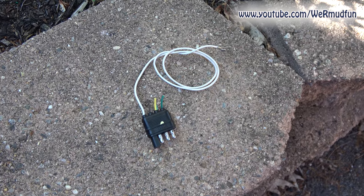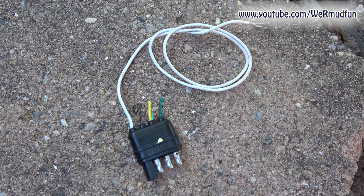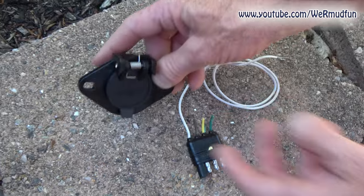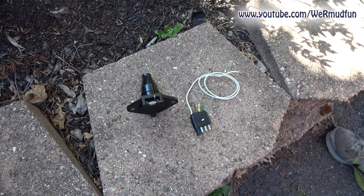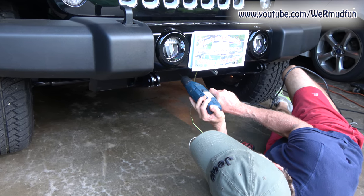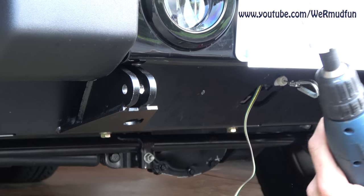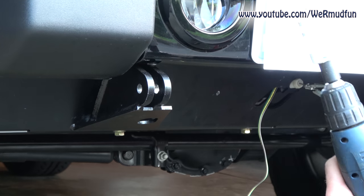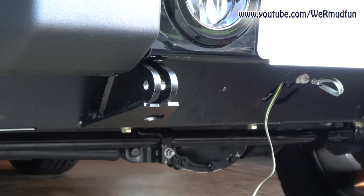The first thing we do before an installation like this is cut off the four-way plug, mainly because with its width it will not fit in the frame and come out where we want it to. The reason we cut it off is we always go with a six-way round, so that we can add extra 12 volts if we need to — such as putting an LED light in the motorhome to let us know when the brakes are activated. I'm going to set and punch a pilot hole, then use an inch-and-a-quarter hole drill. Take your time, and use a little WD-40 if it starts getting too hot — I got that tip from a body shop.